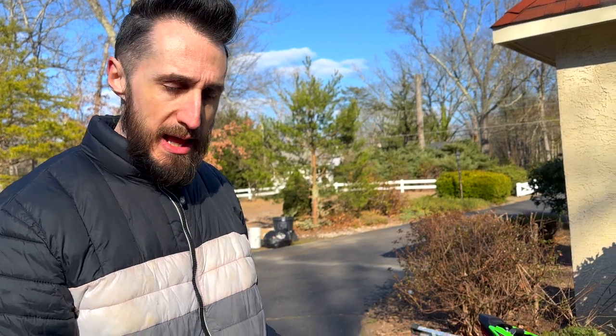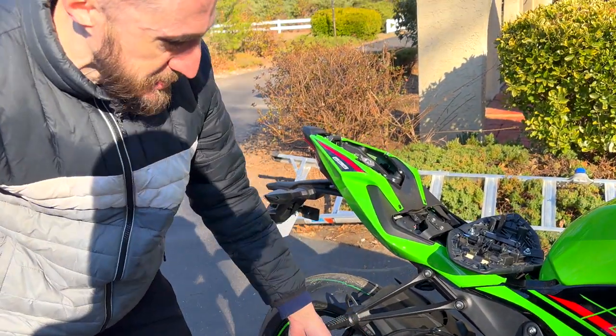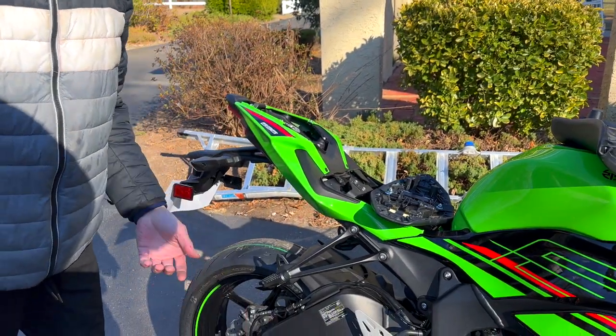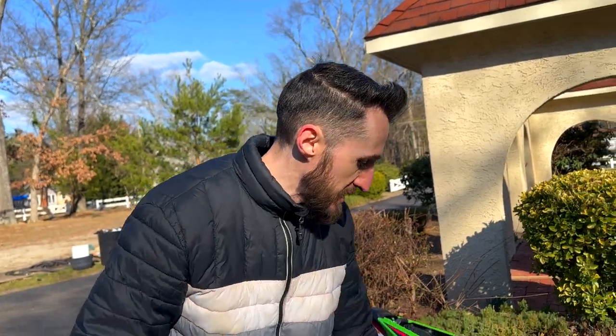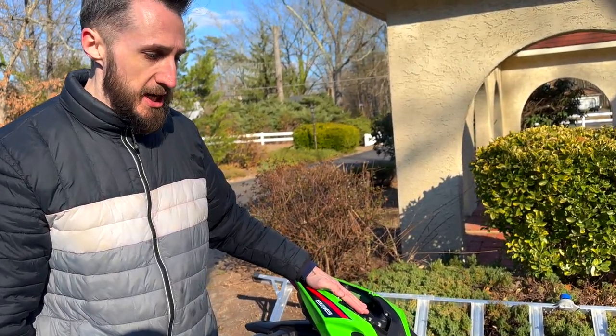Only thing I don't like is that if you're gonna do something like this, it's gonna vent all the moisture on your swing arm. So protect the swing arm with spray, like moisture repellent, stuff like that, and eventually get a slip-on. So we're gonna fire it up. I'm just gonna take these off, fire it up, and show you what a free exhaust mod sounds like on a ZX6R. I promise you, as long as you leave the cables like right here, and as long as you leave the servo motor plugged in, the cables in and untouched, you'll be good.